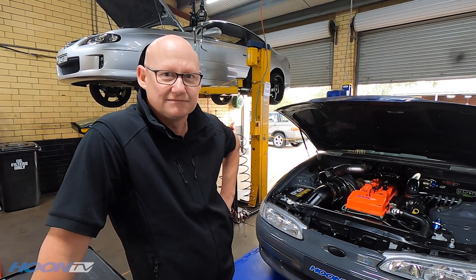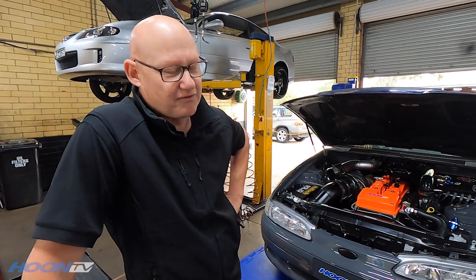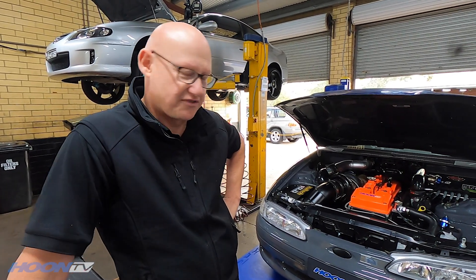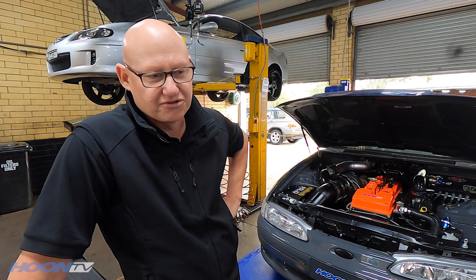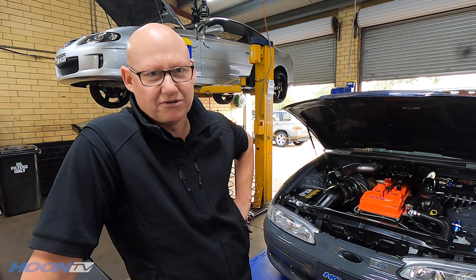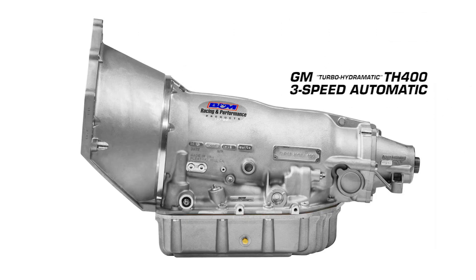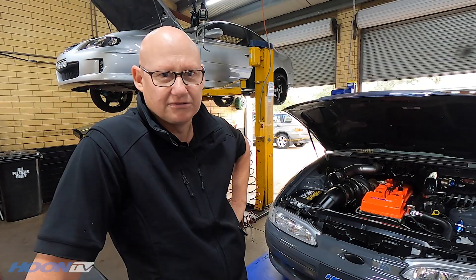What are the advantages of a Turbo 400 with a Barra compared to standard Ford transmissions? Standard Ford transmissions simply lack strength - shaft diameters, clutch surface area. There's no way we can run this sort of horsepower through a traditional ZF or a traditional four-speed auto - it's just not going to happen. Moving on to pros and cons of powerglides and 400s: depending on tyre size and rollout ratios, there's always a debate on what's quicker. We've decided to go 400 in this car because we're going to run radials. It gives the option to launch in second gear or use first gear if everything comes off the hull.